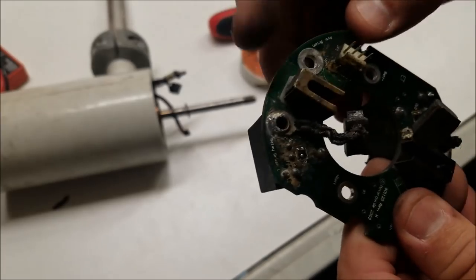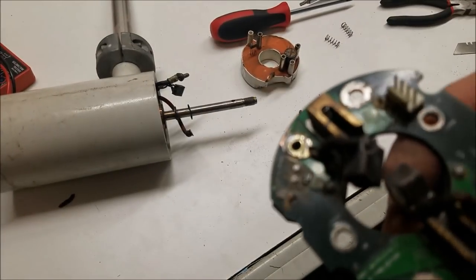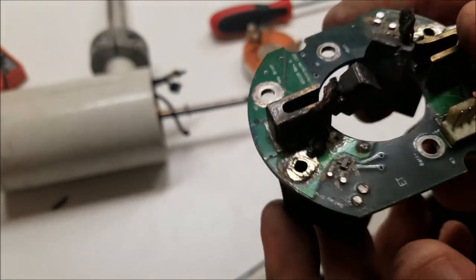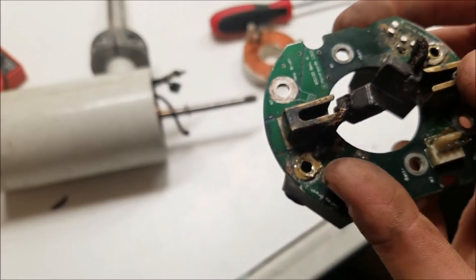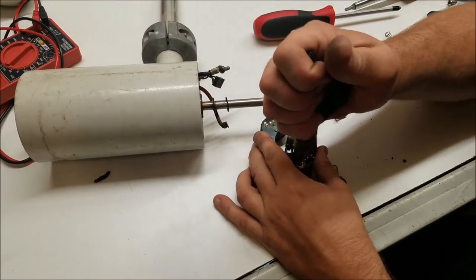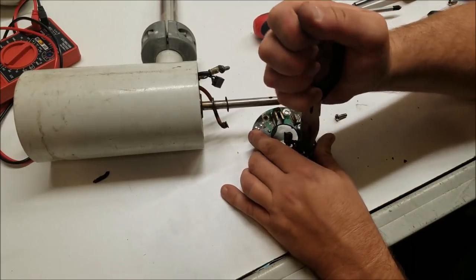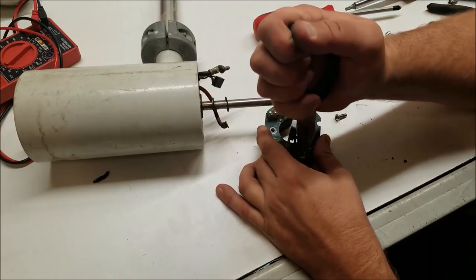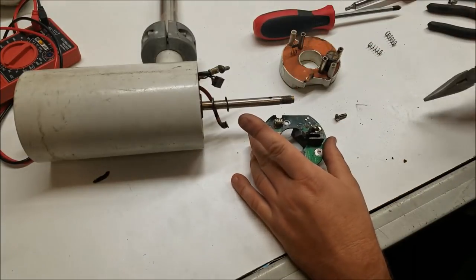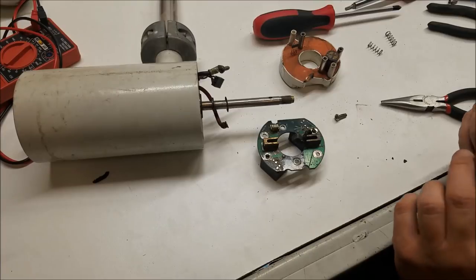The plan is to just grind off this back solder here, along with this brass ring, and remove the brush itself. I don't think they ever planned on anybody replacing these brushes. Plan B - I'm just going to drill at the center and switch it out. I got one out, so that worked. The second one - maybe not so easy. That was pretty stuck in there. Not much wall left to grab. Whatever solder they used, it really worked.